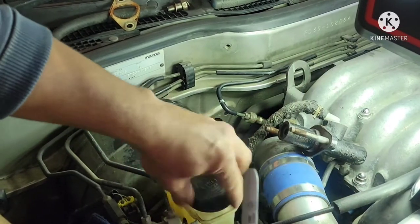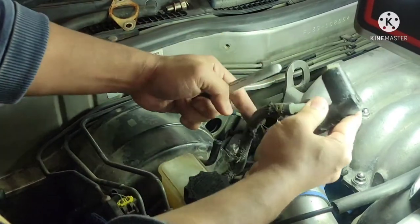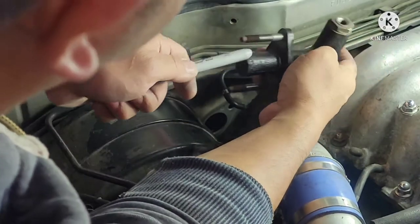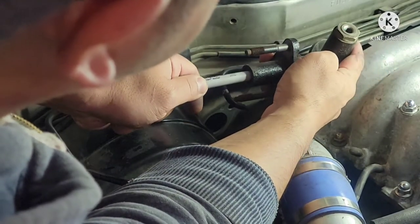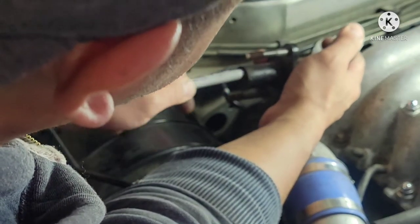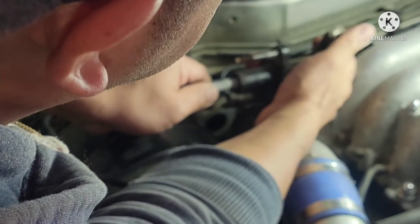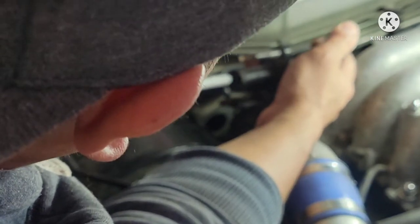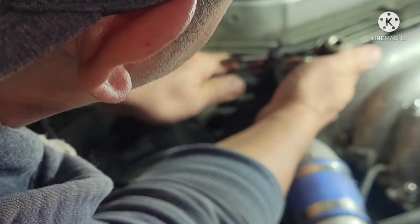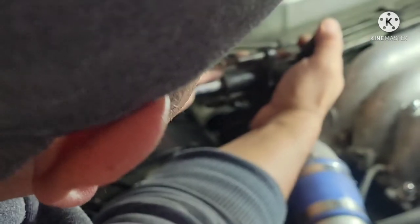Grab a Sharpie or anything soft to plug the hole — this is what I got in my garage. We're going to be pumping this up. When you pump this, just pretend that you're bleeding it out: push the rod in, plug the hole, let it go, and keep doing that. See that fluid coming out slowly? I've got fluid in here now, so this is ready to go.